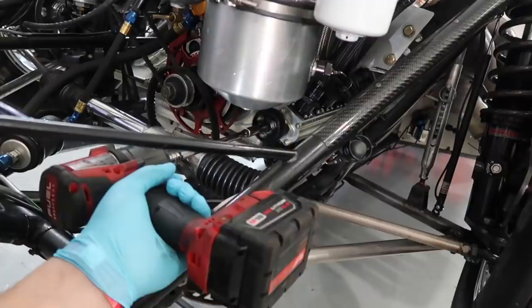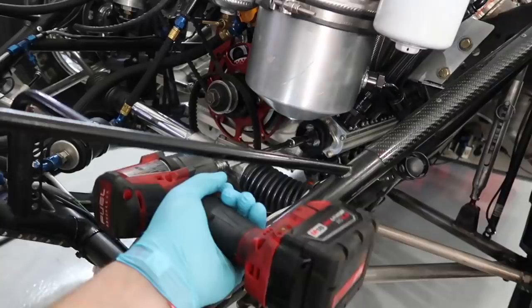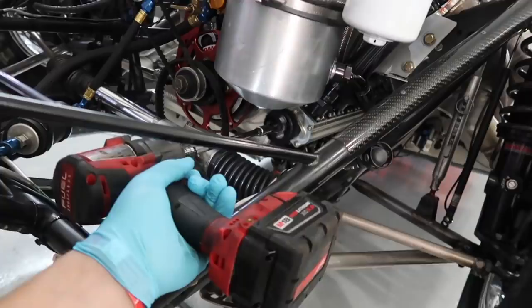And you also gotta make sure you put that oil pump belt back on when you take this off. Usually I'm the only one that primes the motors up because then I can remember to put the belt back on. But if I leave it in someone else's hands, it'll get left off. This motor could run for probably about 4 seconds without no oil going through it before it locks up. Tell me how I know how.